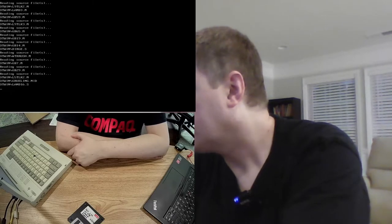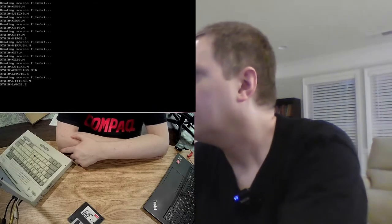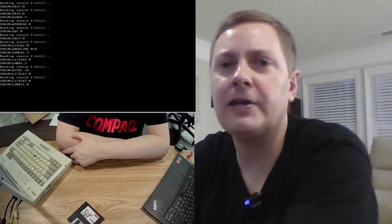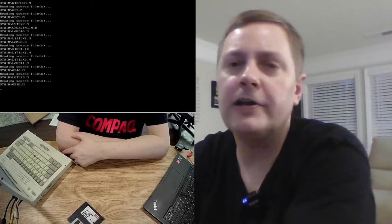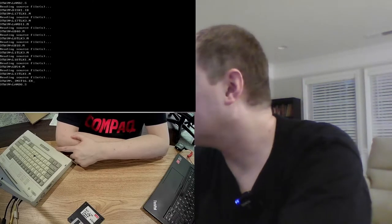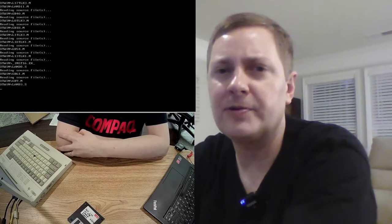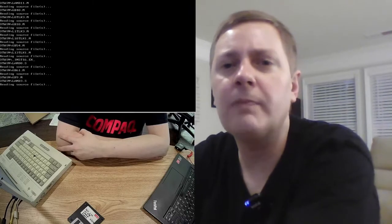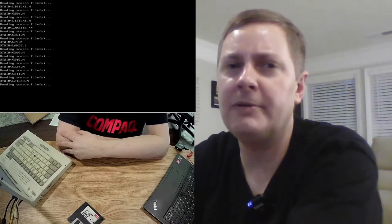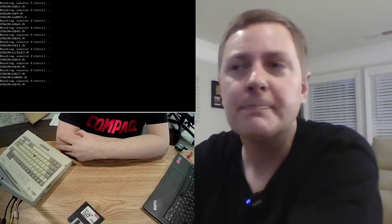Let's see here. Julian, welcome. Glad you found us here. And I'll skip down to your other one, then I'll get back to Tim's. What OS are we installing here? So we're actually copying. I just finished doing a Laplink or FastLynx transfer from one Compaq LTE 5300 to another, and now we are basically moving some things around. That particular installation had a bunch of games, had Oregon Trail, and what I'm doing is taking Oregon Trail and moving it from one drive to another so I can make it common, because the next thing I'm going to do on this machine, now that 3.1 and DOS is installed, is install 95.